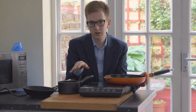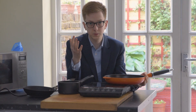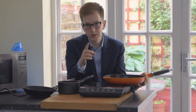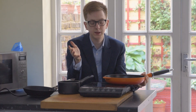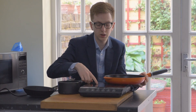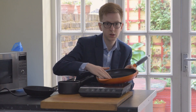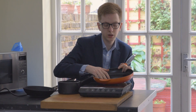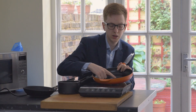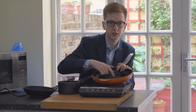With a gas cooker, electric hob, or ceramic hob, the flame is the heat source and it heats up the pan, or there's an electric ring that heats up and the heat transfers into the pan. With an induction hob like this one here, there's a magnet in the hob that switches off and on really quickly, and in doing so it heats up the pan. Without getting too technical, what it's doing is pushing an electrical current around the pan, and it's the resistance of the current against the pan which heats it up.